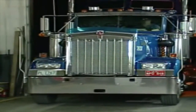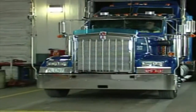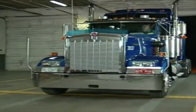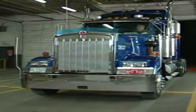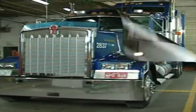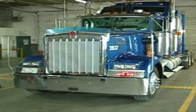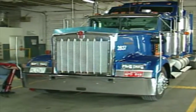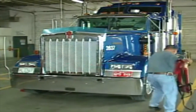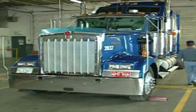The first step is to drive the vehicle in straight and roll it to a stop so that you have the as-driven position on all the tires. This is important in order to make sure that your measurements match the tire wear conditions in the vehicle. The next step is to set up your targets on the front of each tire so that you have a reference to aim your drive axle lasers at. Each target goes down with a zero measurement against the tire at the bottom center of the tire.